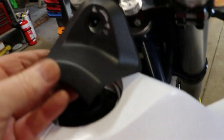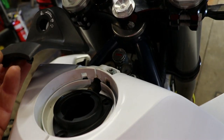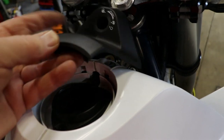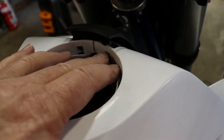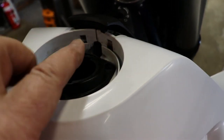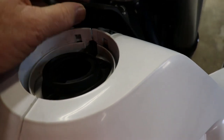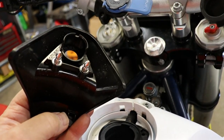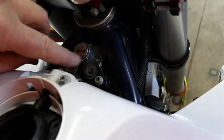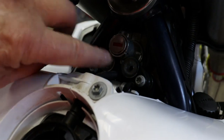So this is the ignition cover, the ignition's key entry ignition cover. That basically clips in, but to get it out, there's 2 points in here. There they are there. You get a screwdriver, clip it into those 2 points, deflect that tang there. Then it's just a matter of a push in. See the two push in tabs there, and they push into those two plastic or rubber positions there.